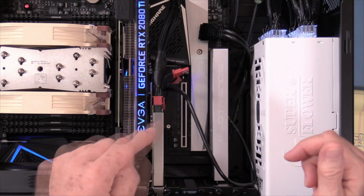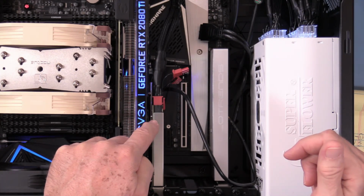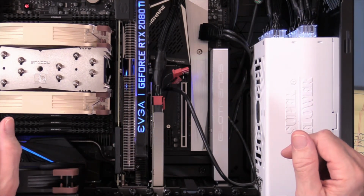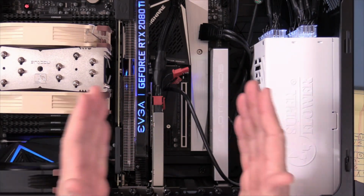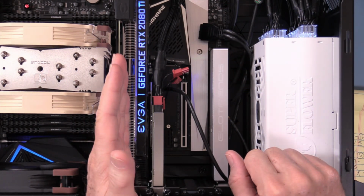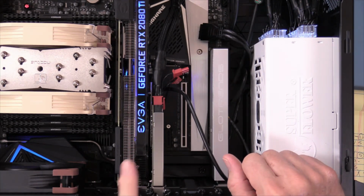And we still don't have all our issues with lane assignment with this card yet, but I still think it goes back to the root port selector that's hardwired. We're going to be doing some Thunderbolt 3 stuff very, very soon once we can get out of this NVMe. But I've been trying to do this for a month, so I'm eager now to get this video card done. So that's what's in there. I got to turn the machine off, and we'll go to the next one.